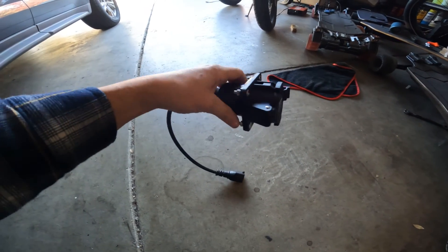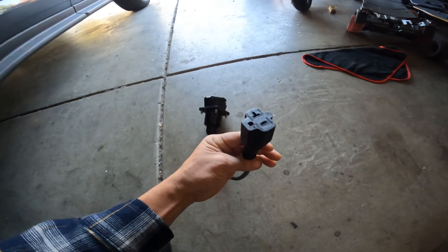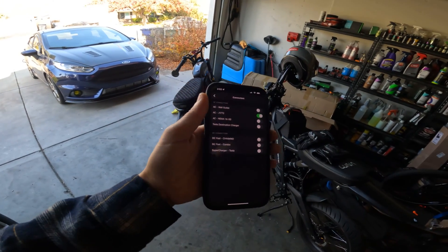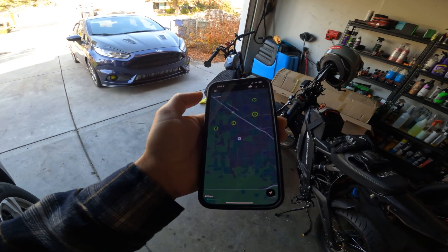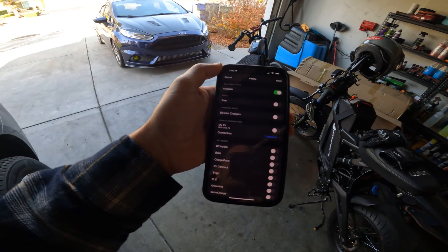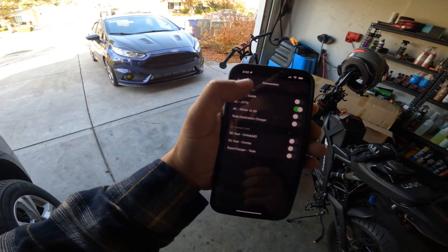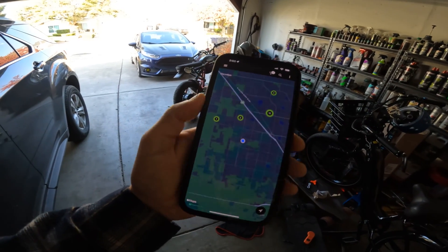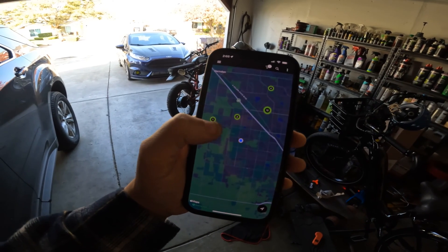This connector is basically going to trick the charging station into thinking it's plugging into a car, and the other side of it goes to an outlet to allow you to plug in your charger. Once you get the two parts — which are going to take a while because they normally come from China — you download the ChargePoint app. Go into the settings, into the filters, and select only the J1772 connector. That's the only one that's going to work, and then you'll notice on the map it's going to show you where the stations are.